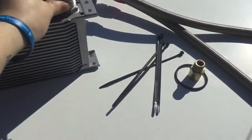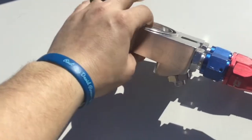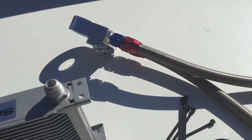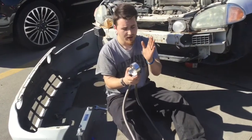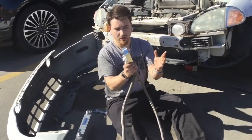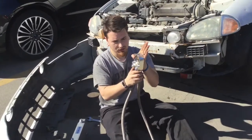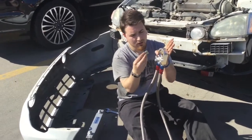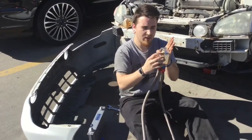The mod is an oil intercooler. You hook this up to where your oil is at. So where you normally would put the oil filter, you're gonna put the sandwich plate next to the block. Then you're gonna add this adapter — it has male and female threads — and you're gonna thread this in hand-tight first.